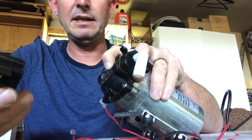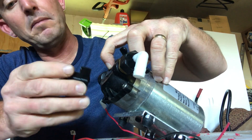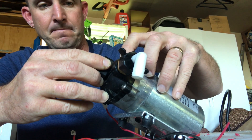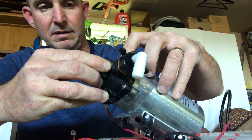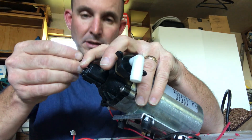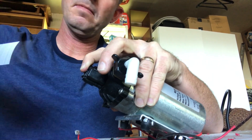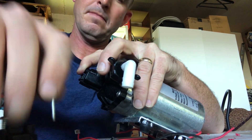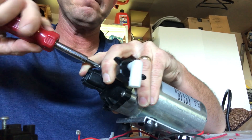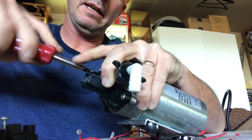We've got the diaphragm in place — we don't want that to release. So we hold it in place and line up our screws. There are tabs to hold them in place, so we slide that over until those tabs line up. Once the tabs are in place, we hold the whole mechanism in place, take the screws from our old pressure sensor, and get at least one of them started. Once we've got two in place, we'll get the third one tightened down and make sure everything is tightened down so that it stays watertight.